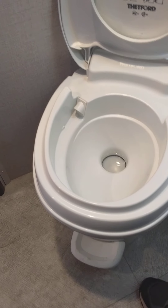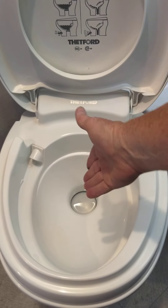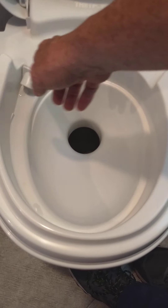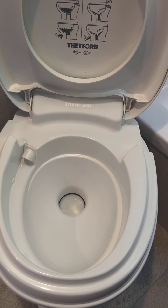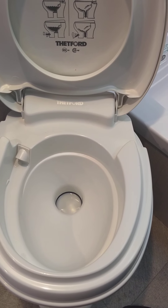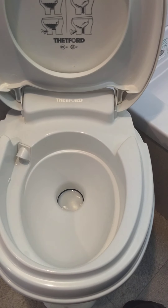You always want to run the fan when you're using the shower because it will pull all the humidity out. The thing to remember with the toilet is you can't use it dry and you can't use it without chemical. When you get to the campsite, stabilize your trailer, hook up the power and water, then come in here, take your chemical and put one dose right in the toilet. Then step on the pedal — because there will be water hooked up, it'll come swirling out. Put about a gallon or two of water in there. The bottom line is you have to have a little bit of water and chemical to start using it. So anytime you start with an empty black tank, you've got to put chemical and water in it. If you had to dump the black tank mid-trip, after you dump it you'd come in here and repeat that procedure — chemical and about a gallon or two of water.